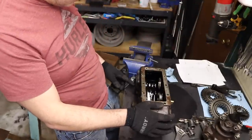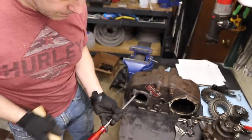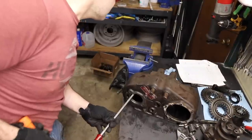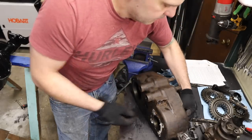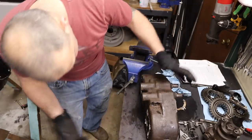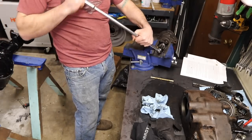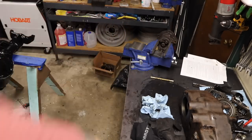We've got a bearing race in here behind the seal, so I'll take that seal out. Okay, seal came out. It looks like this section comes off — it's got bolts in it. Schmoo central. Slip fit — didn't expect that. So we need to measure the end play on this: 20 thousandths — too much. That yoke isn't even tight. Not yoking — it never gets old.